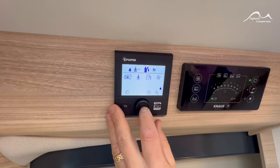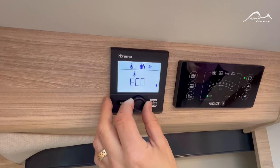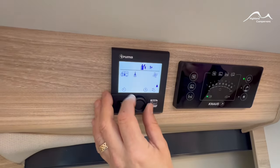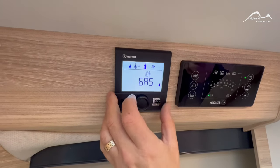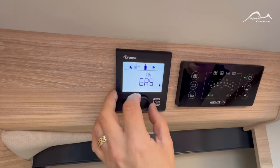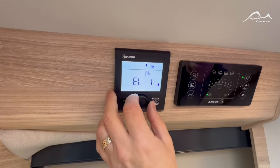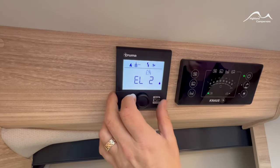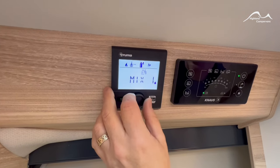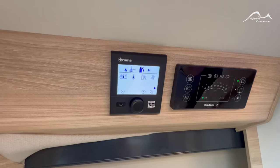For the water heating system — once you've purged the water through and have a continuous supply — you can set it to an eco mode to heat the water up to around 40 degrees centigrade, or turn it up to 60 degrees for a shower. If the symbol starts to flash it means it's drawing the water through. This is a CE model so you have the choice of gas or electric. Select the gas bottle symbol for pure gas mode. For electric mode, scroll through to electric one or electric two — approximately 900 and 1800 watt elements respectively. If it's really cold, you can set it to mix one or mix two, using a combination of gas and electric to speed up the process — it doesn't make the water any hotter, it simply speeds up heating.